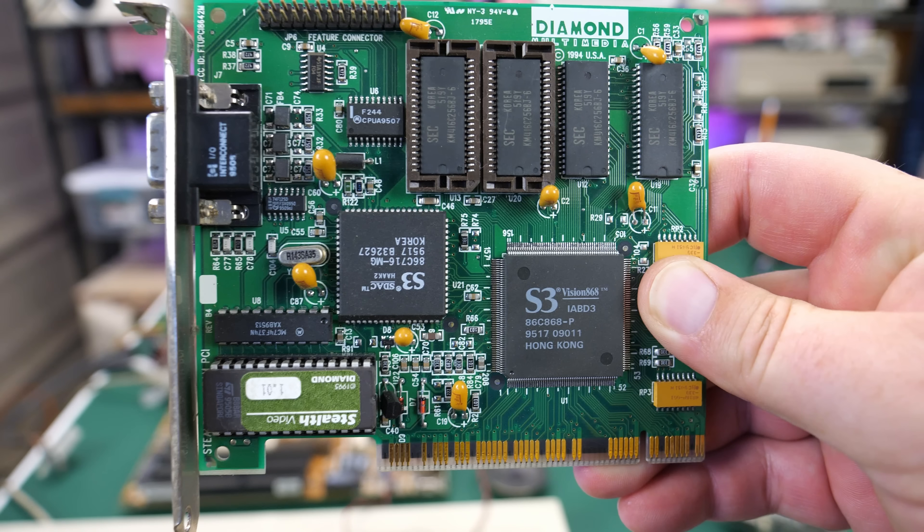I went ahead and tested the power supply by hooking it up to the hard drive with nothing else connected so there would be some load on the system. I tested the rails and they look good — actually perfect: 12 volts and about 5.01 or 5.05 volts. I've also already tested the rails on the motherboard while the power supply was disconnected, because there are some tantalum caps on the cards and on the board itself. So far I think things are in good shape, as long as my pin straightening didn't damage anything on the processor.